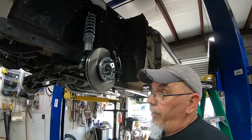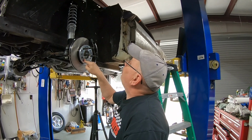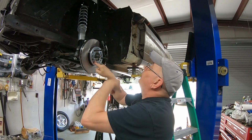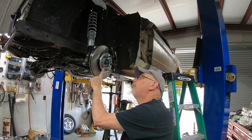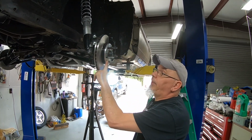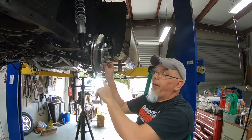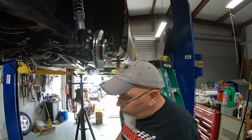So I had to order wheel spacers, because they are a hub-centric design. I didn't want them flopping all around and carrying on with several different lug patterns on there. So then that required me to get longer wheel studs, which I'm sure Wendy's going to hate. But it is what it is. It was an unexpected thing. I never expected the wheels not to clear the brakes. So, you know, hey, my fault. But anyway, let's move on over here.